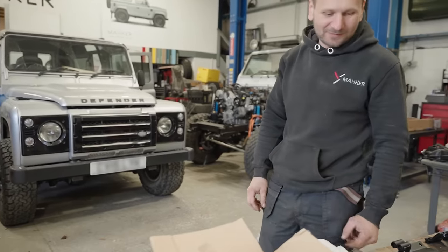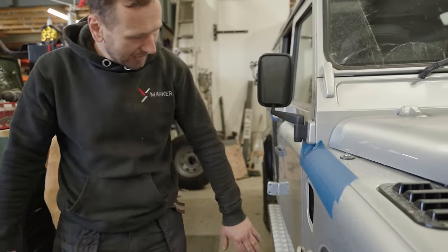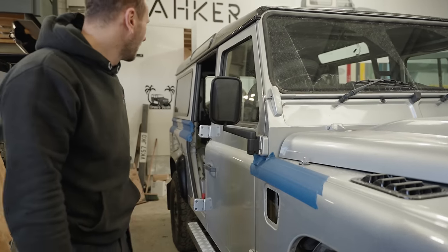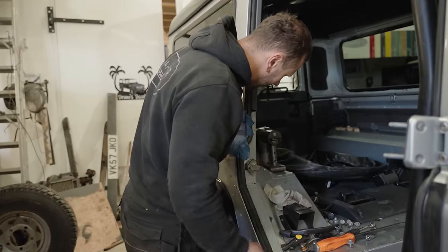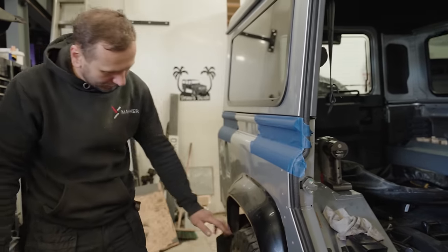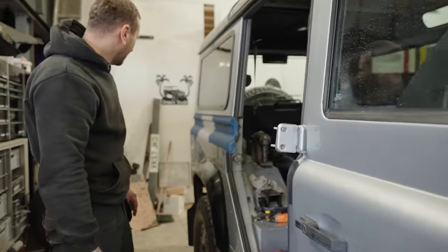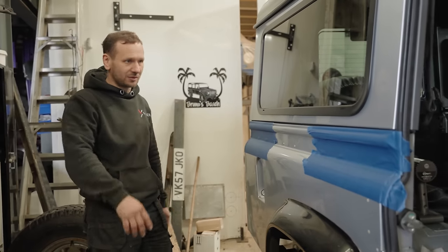Good. So it's a Safety Devices roll cage? Yeah. How many points of contact does it have? It's going to be a leg that goes here, inside there, the wing, bolts to the chassis, and you bolt here to the roll cage. It's going to be another one over here. It's got a bracket that goes inside there, and another one goes in here somewhere, I think. And another one here in the back. So you've got like 3 points on each side.